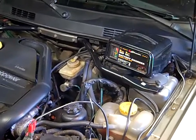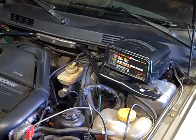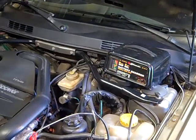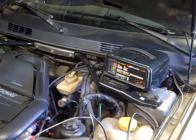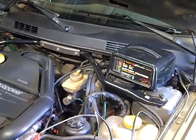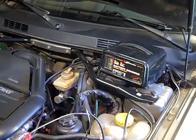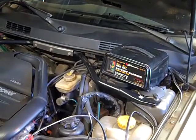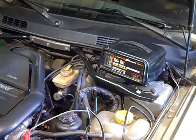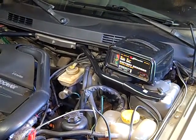Now in diagnosing the hard brake pedal, there are a couple of things that are common on these. This is a 2001 9-3, old generation 9-3. Sometimes the brake boosters will fail on these, but usually when they do it's kind of gradual. You may hear a little hissing inside the car from the vacuum leak, and it's most noticeable when you first start the car up — the vacuum has leaked out of the booster. When you back up the first thing, you'll have that stiff brake pedal. But usually once the car runs a little bit, the pressure will build up in the booster and it may drive normally. As it deteriorates further and the leak becomes worse, you may lose all your assist. That's a fairly common thing. It's expensive, no fun to change, and I'm glad I don't think that's my problem here.